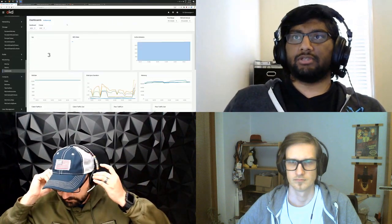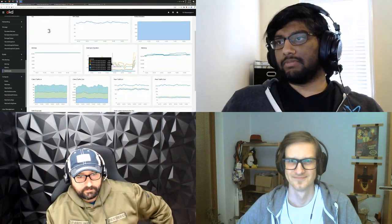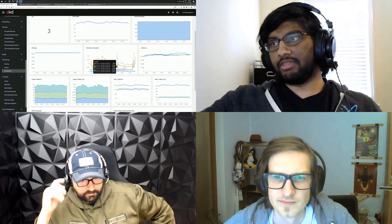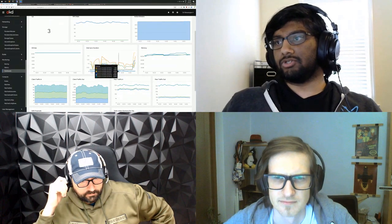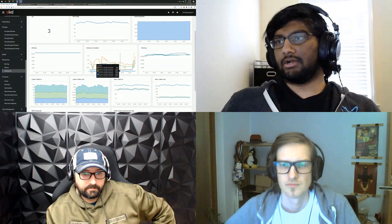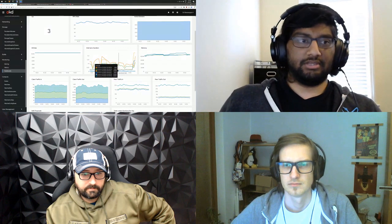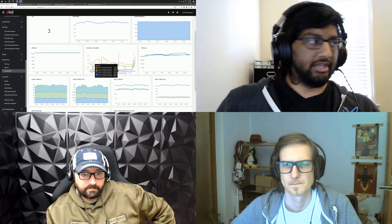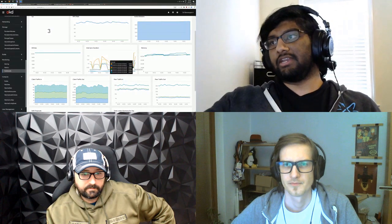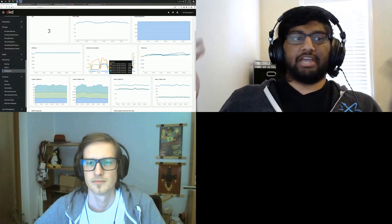That's what the world's worst dashboard likes to show me a lot, because of the disk sync durations here. You'd see four of them are up in the too high range, and then one of them is at 6 milliseconds, 4 milliseconds, and the other ones are like 100 milliseconds and 90 milliseconds. It's identical hardware. I have no idea. They're all almost the same spec. I think the only thing different is the motherboard. Very, very weird. And now that I'm using it, these both spike up and the third one is just fine. I have no clue.